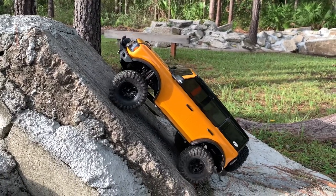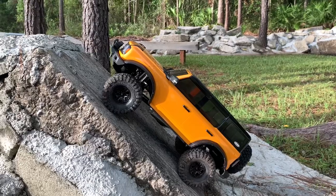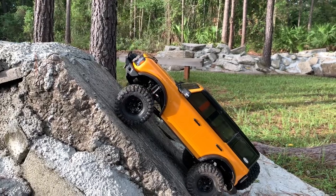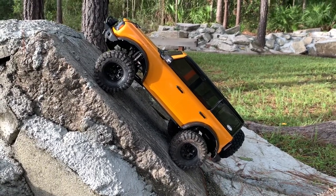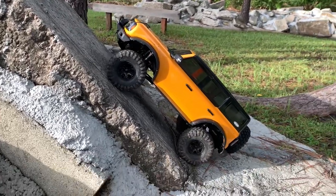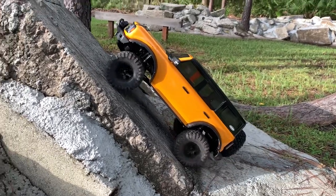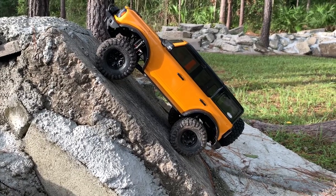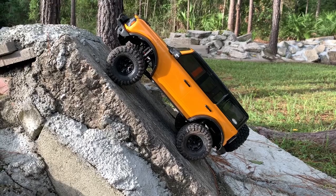Nope. I can try to hold it, but like with other systems, if you give it a little bit of reverse throttle, or in this case, forward throttle to hold it, this one just simply drives. There we go, back into first, and it holds perfectly. So yeah, you can overgear this and you'll lose that awesome drag brake holding ability. It seems a little bit slower than the stock system, but it's got more power, much better control, and there's less stuff in the chassis to deal with.